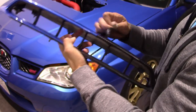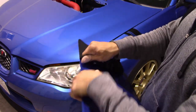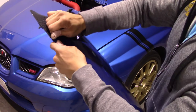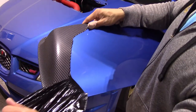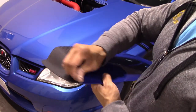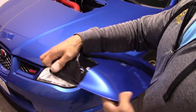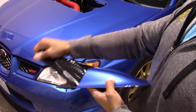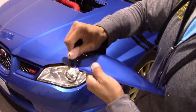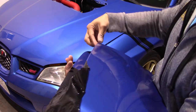When heating, try to heat a big broad area to soak the whole area with heat so you can peel more vinyl off at one time. Definitely don't want to concentrate the heat in one particular area too much because you'll probably burn a hole or melt the vinyl when heat is concentrated. With a heat gun, it puts out a lot more heat than a hair dryer - talking like a thousand degrees on high, maybe 1100-1200 depending on which heat gun you have. As you can see, everything's peeling off nicely with no glue residue so far.